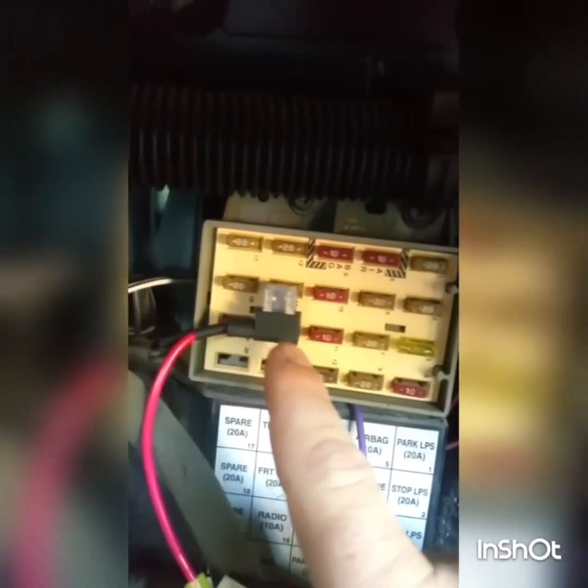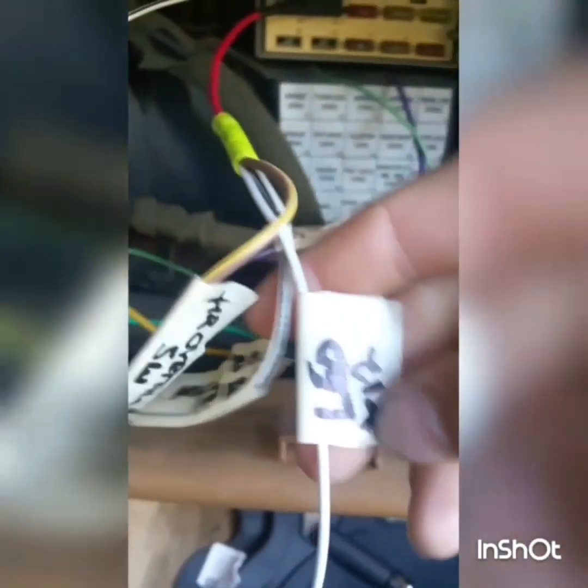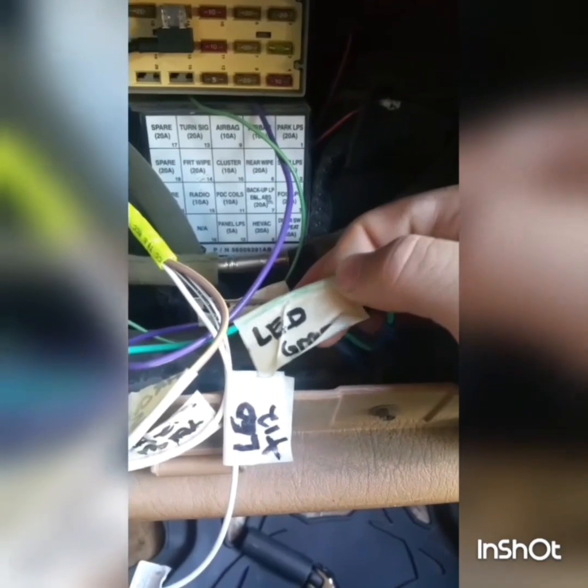The wiring goes straight back to the fuse panel — the fuse block behind the glove box. I removed the radio fuse and divided the circuit: seven and a half amps for the radio and two amps on the switch side. Three wires go in there: one for the override switch, one for the LED 12-volt side, and the yellow wire is the auto-on. Then the LED ground comes from the motor ground circuit, and then the override switch.